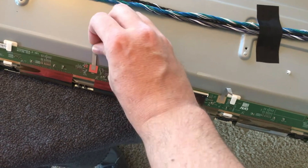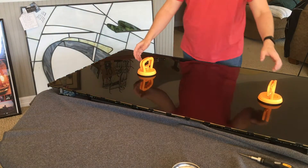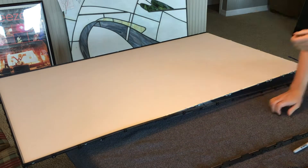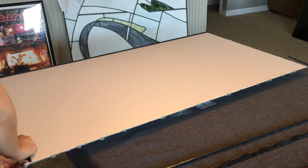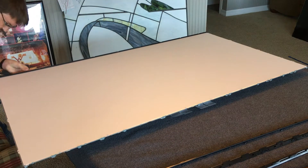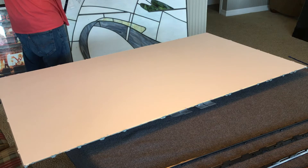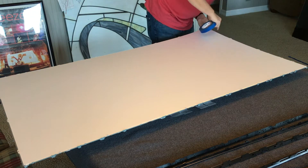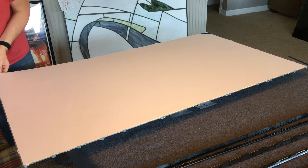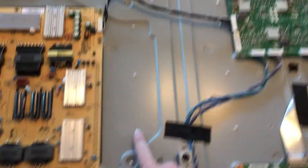This goes through the process of how to dismantle everything. Those suction cups help pull the screen off so that you don't break or crack it — those are very fragile. The suction cups are literally like $2 or $3 at Harbor Freight. Use your super coupon and get them for really cheap. These are the diffusion panels behind the screen of the TV — I'm just taping these to keep them bundled together. There are several layers of diffusion and the tape just helps keep them all straight.